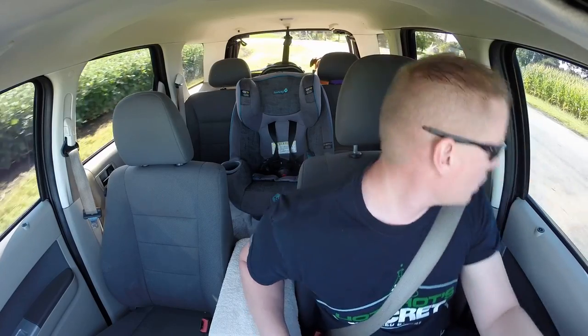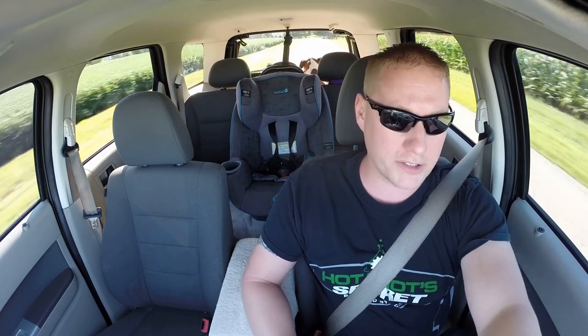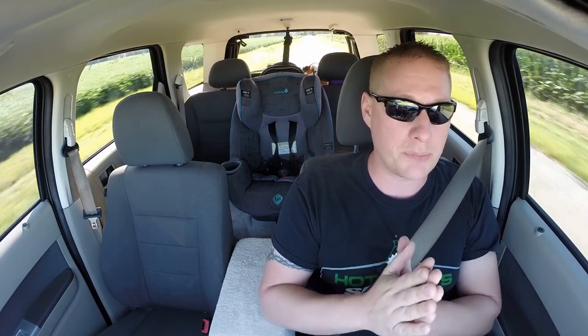You may have to do this on your own in your own city or town. Okay, 30 to 40 miles an hour, 35 to 40 — moderate pressure — don't ease up, keep it all the way until you actually stop. We're going to repeat this three, four, or five times until the pedal feels normal again, meaning the surfaces are mating, they're gripping, and that coefficient of friction is there.